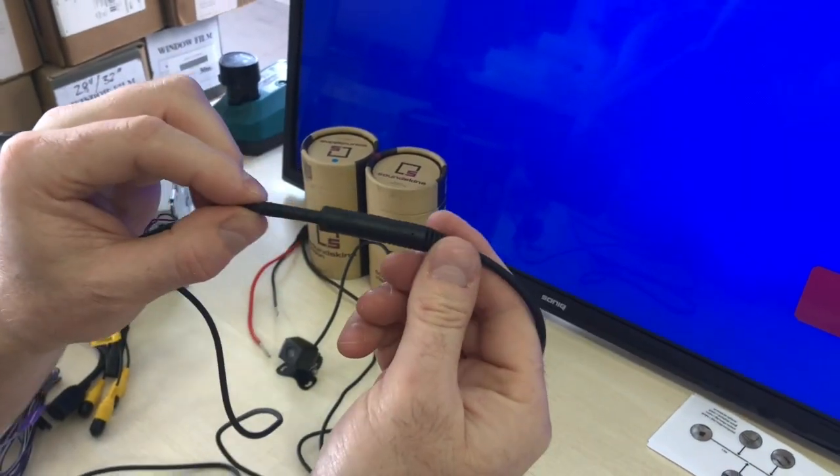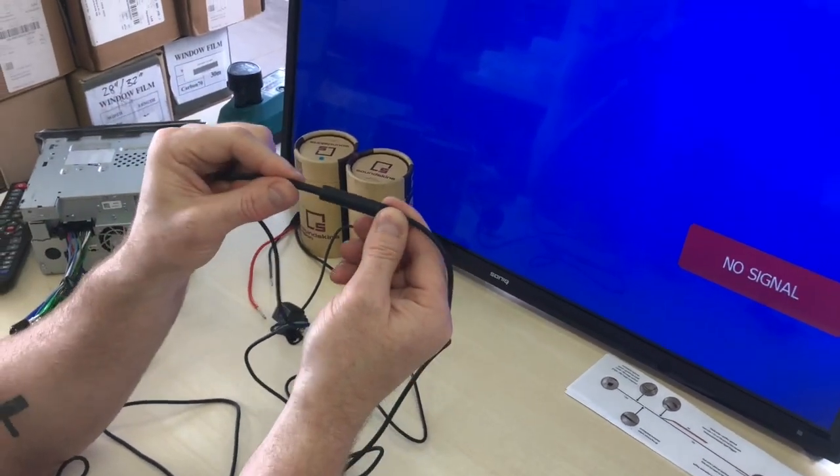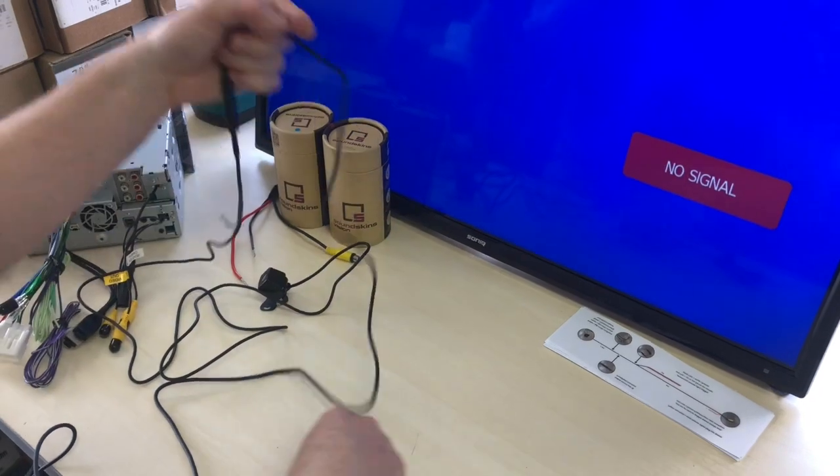And you actually feel it, it'll slot into place, and there's 2 little arrows. And the reason being is the pin configuration, the way they actually form, the 4 pins, is very important that they go in that way, okay? So that is a waterproof connector for at the rear, and it makes a very slim line for running your cables. So that's very cool to start with.